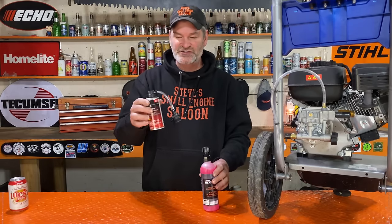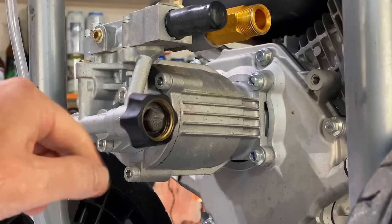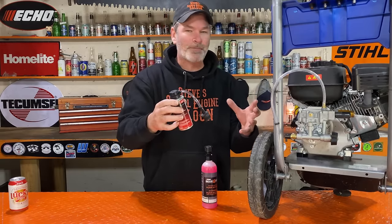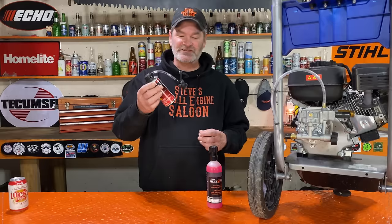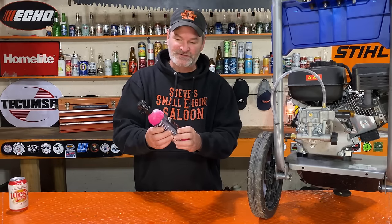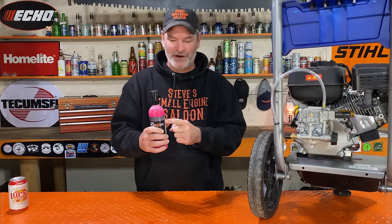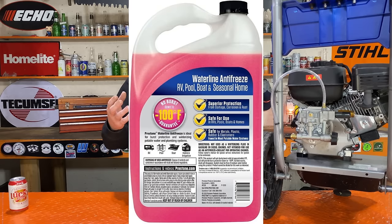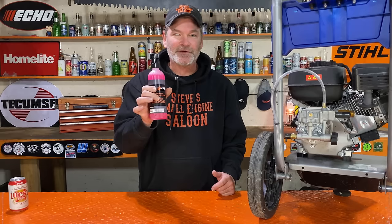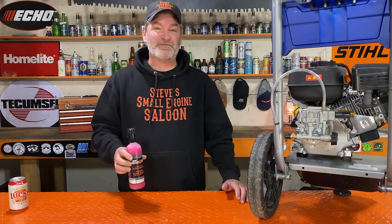Here are a couple of options. There's an aerosol one — a Briggs and Stratton pump saver. You screw that right into where the garden hose goes, shoot it in there, and it replaces the water, protecting all those little rubber parts. The reason I don't like the aerosol ones is because they're only good for treating your pump about two times and then you throw it in the garbage and buy a new one. I really like these little squeeze bottle ones because when it's out you can save the bottle and refill it with RV antifreeze or plumbing antifreeze — it's the same thing. You can keep reusing that bottle. I have links right underneath this video in the pinned comment and in the description. This stuff is really not very expensive.